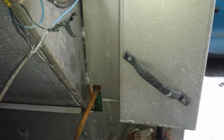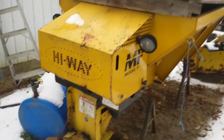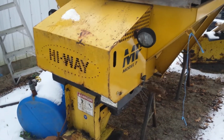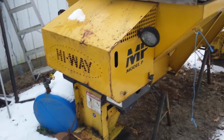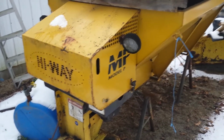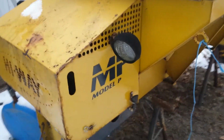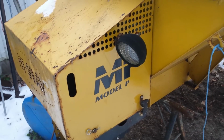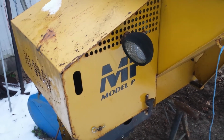So my salter's in. I think I showed you that last week. Salter's working great. I'm putting one up for sale. I got an older one here I'm going to sell. Here's the one I'm going to sell. It has a 10 horsepower gas engine, but when you get down in those minus 28, minus 30, unless you have this in a heated shop and start it before you leave to go do your run, it won't stay running. They have a hard time starting these motors when they're at the back of a truck going 100 kilometers an hour down the highway. So this one's going up for sale. It's in good shape.